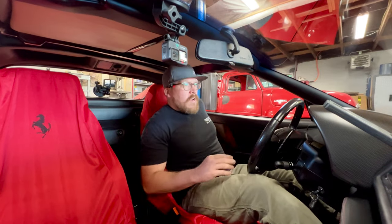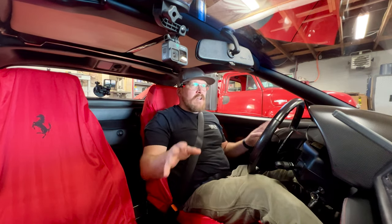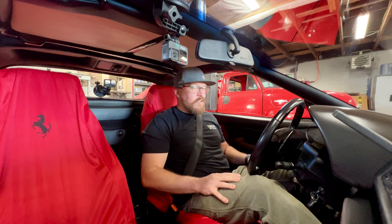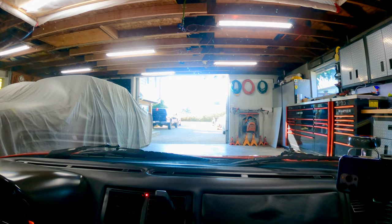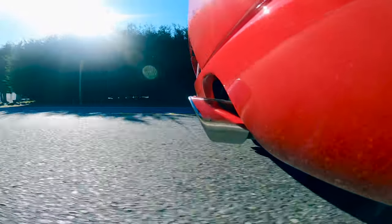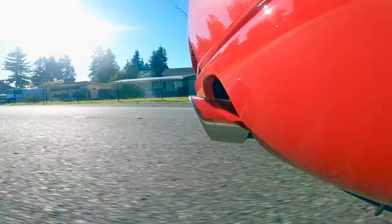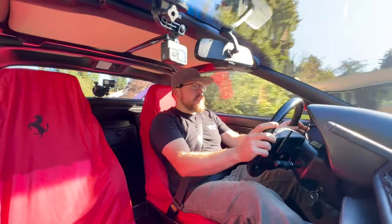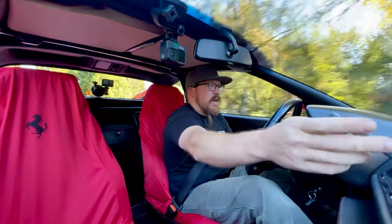All right, she's getting warmed up. We're at 190 degrees. Throughout the drive, we're going to continue to check the operation of all of our controls, our blinkers. Horn's working great. So I think we're good. Pop her in gear and we'll head off. Mode, so it's doing all the shifting. One thing I immediately notice is that our LED for our gear indicator is missing a few pixels. Again, client obviously knows, but we're going to document that and notate it down.